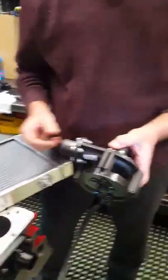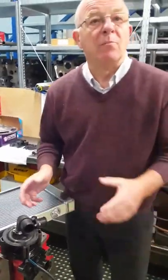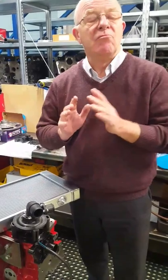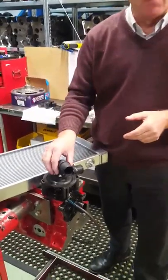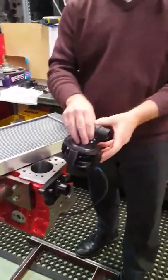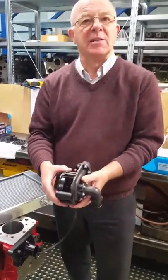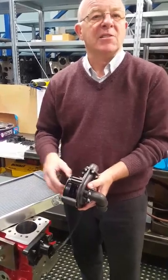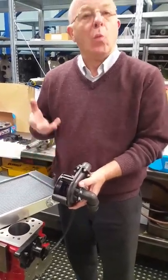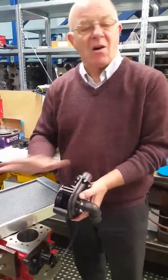Another main reason for going electric is that it's not driven by the engine, so the speed is independent from the RPM — the pump runs at its own speed with no respect to the engine at all. The beauty of this pump is it doesn't sap power from the engine. Also, you can run the engine without the pump running — start it up, warm it up to a reasonable temperature, then switch the pump on so water starts flowing.